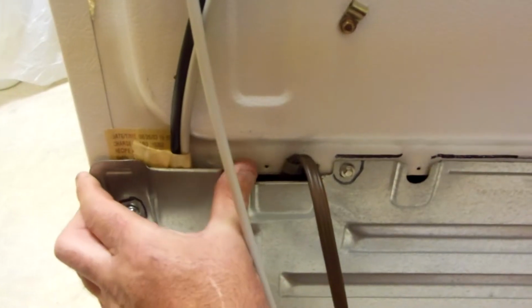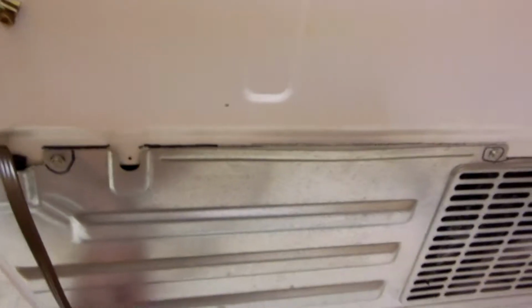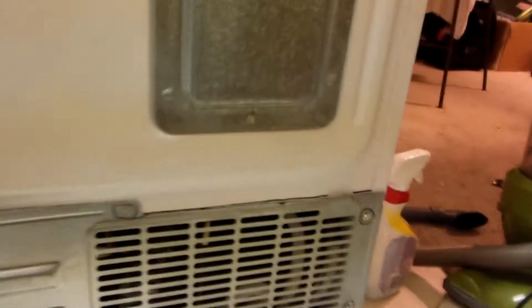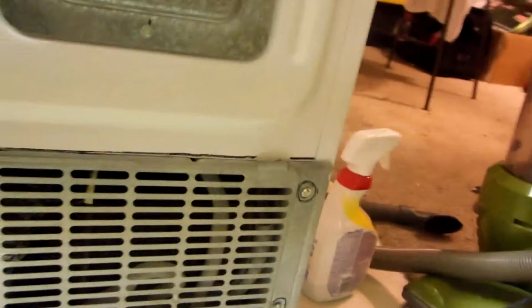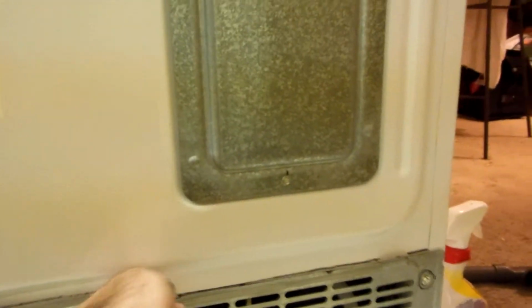Because as you can see, these panels need to have movement to line up properly. So if you tighten all the screws, you might not be able to get one screw in, or it makes it a pain in the rear. So anyways, I put all my screws in with my drill gun first. Just put them in 3/4 of the way in until you've got all the screws in, and then you tighten them up. But don't use the drill gun on the refrigerator.